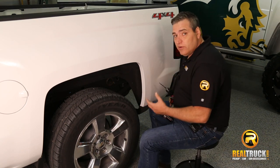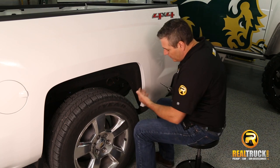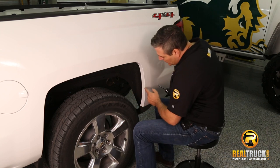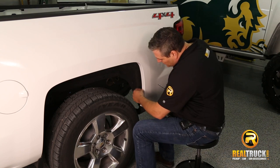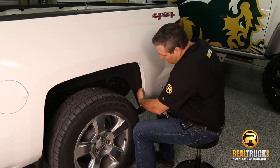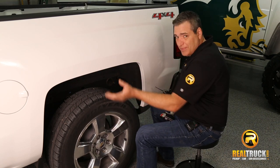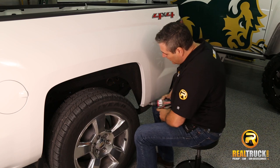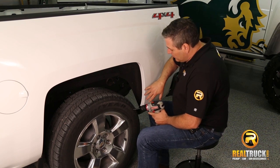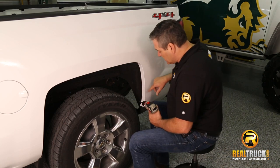The first thing we're going to do on the rear is determine how high our mud guard is going to come up on our fender. Simply hold it up and see where the top of it hits so we know where to drill. One really cool thing is that these fenders come from the factory with indents already — we're going to use one of those for our mud guard. We'll drill it out and show you how to install the clip so we can put a screw in here to hold our mud guard on.